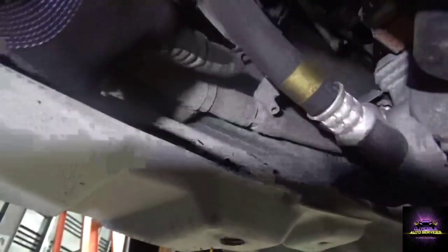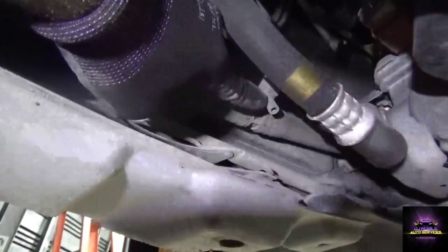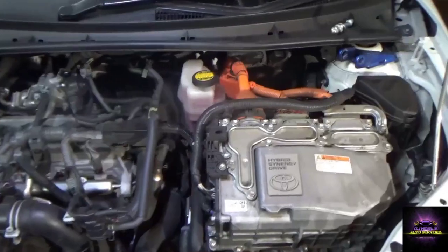What we're going to do is take off the undershield. This plug here is for the inverter; the next one on the radiator is for the radiator. If you want, you can put a clear hose here and let it drain now. We're going to drain the coolant from this line, which is the inverter — let's crack it. Normally I run a clear hose, but in this case we'll just let it run. Just leave it there and let it drain on its own.